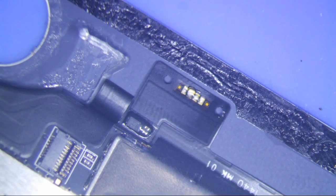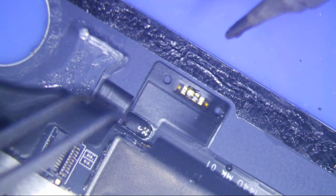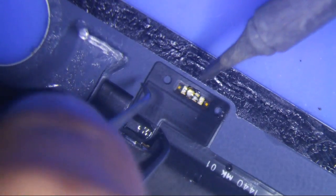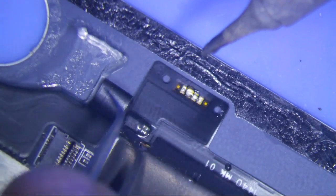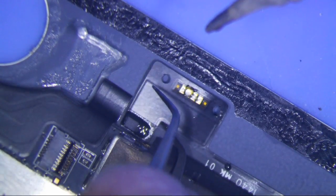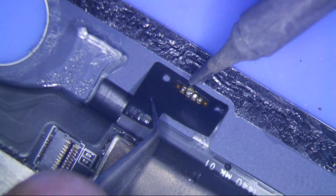I have an iPad Air 2 here and I'm going to show you a soldering job to take off the sleep-wake sensor. I've already taken the tape off and I've already put a little bit of flux on the four pads. You can do this with any old cheap iron really. Just make sure it's hot enough. Just get a little bit of flux and kind of peel up like this.